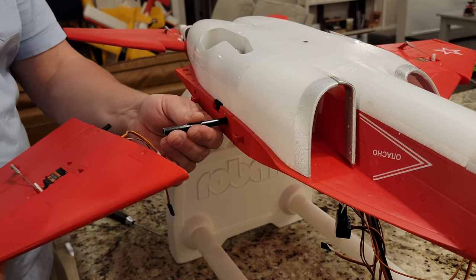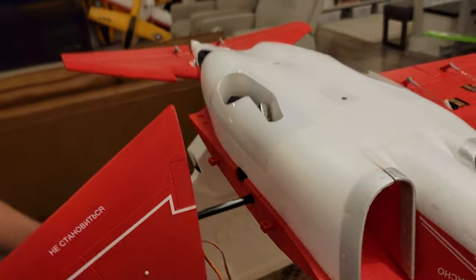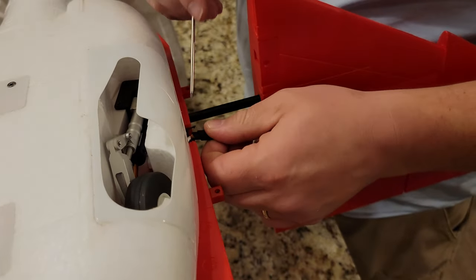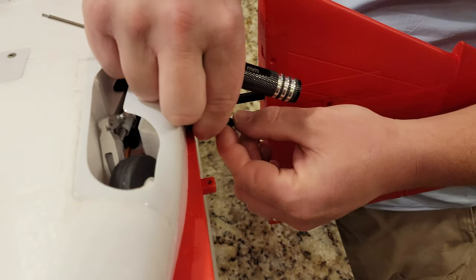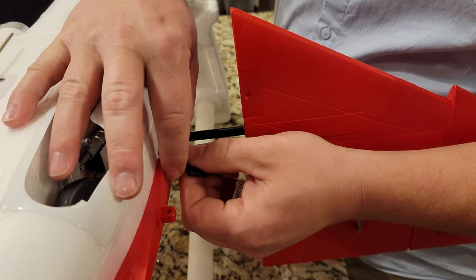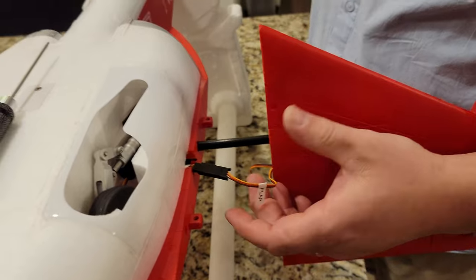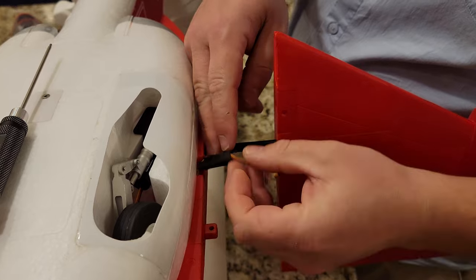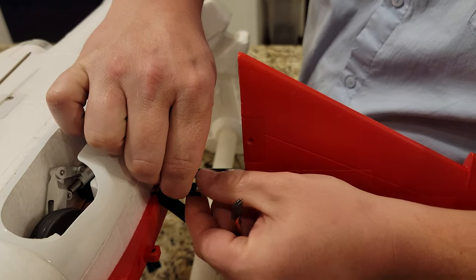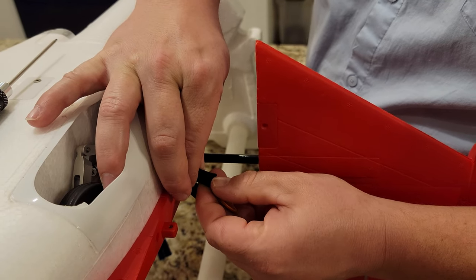You can actually pull the spar back out a little bit and use that to brace it. Flap - there's what I believe to be the flap. Brown is back toward the tail of the aircraft. I'm just conditioning the cables to be in the approximately correct position. My middle finger is making a flat so I can slide that in, pressing against the plastic not the wire so I don't cut it.